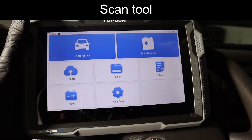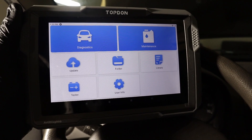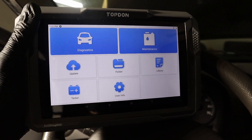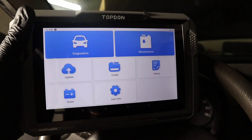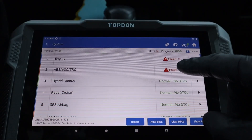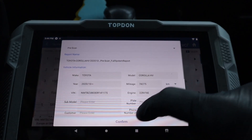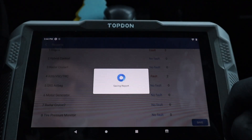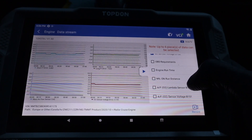The last main type is the professional scan tool. These tools are made purely for diagnosing and servicing vehicles. They are more expensive, but even on a budget you can find interesting picks — for example, the TopDon, which can be found for around 300–400 dollars. Scan tools allow you to work with all control modules in your vehicle. While simple Bluetooth adapters and engine code readers only read codes from the engine, with a scan tool you can access all control modules, read full live data, and perform bidirectional testing in each module.